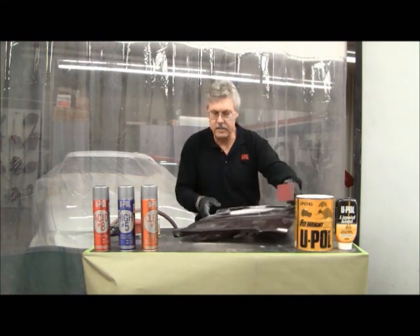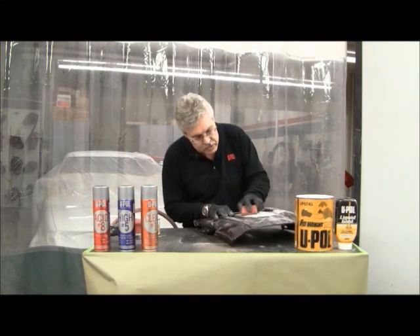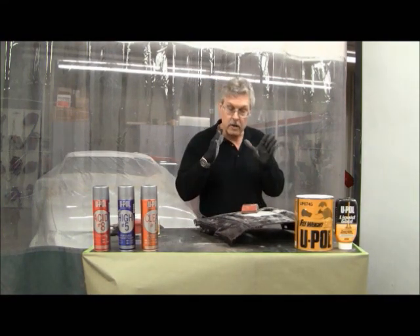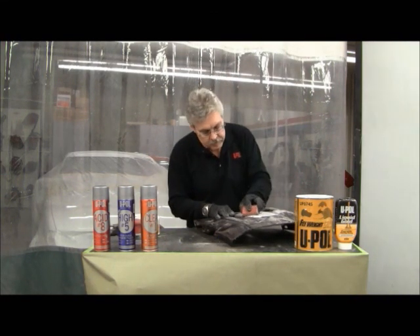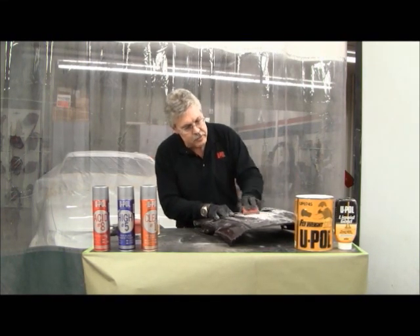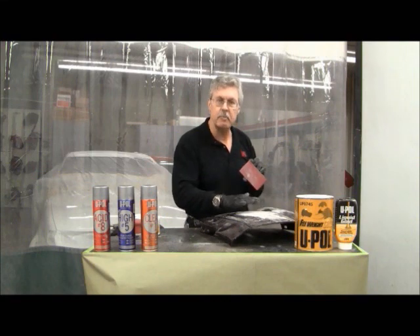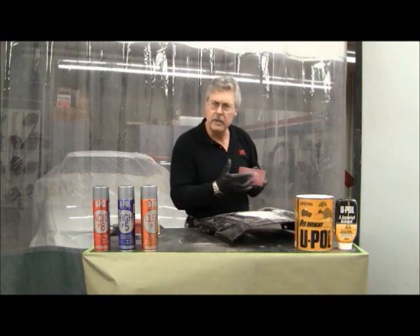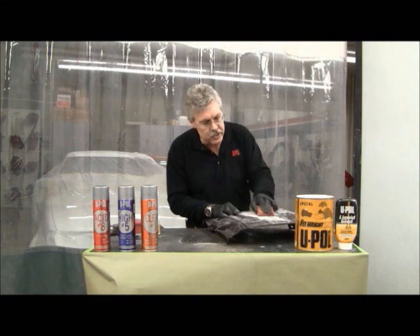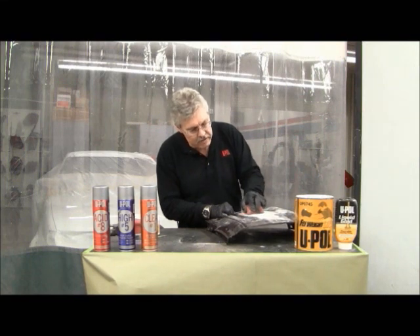Just to give you an idea — we've switched to 80-grit on a hand block. I can come back in and sand this material by hand. Quite honestly, it doesn't matter if we're sanding it now, tomorrow, or a week from now — this product always stays as easy to sand as it is right now. And frequently I like to show people that even when we're hand sanding this material and removing product, there's minimal paper loading. Even though this is a very soft product, we get almost no paper loading — maybe a little bit of dust loading — but very little actual glazing over the paper itself. That's one of the features that technicians really like about this material: whether by hand or with machine, it just powders off very, very nicely.